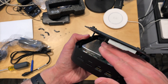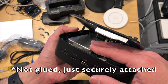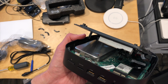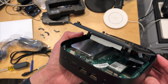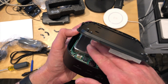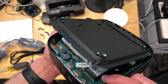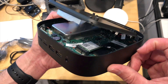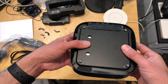The RAM is underneath this metal shield here — it's kind of glued down to the motherboard, or at least snapped in very securely. It is DDR4 RAM and you can insert a pair in there. I'm pretty sure this one has a single stick of four gigabytes, but you could stick in another stick and go to eight, maybe even 16 — so that is an option. Right here we've got the wireless card that looks like it's Bluetooth and Wi-Fi, and right here you've got the M.2 SATA drive. So you have the ability to upgrade RAM and storage, but they do not make this easy to do.